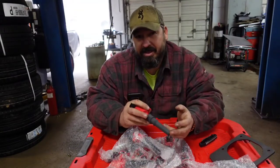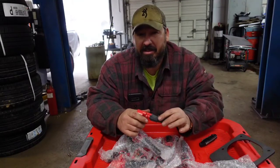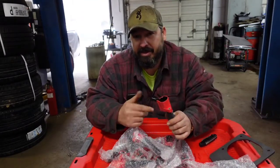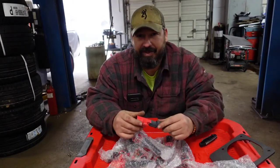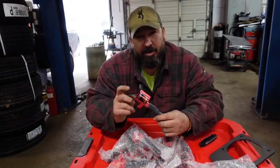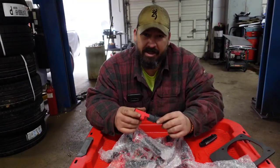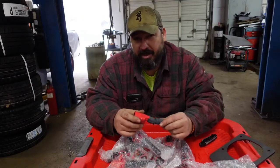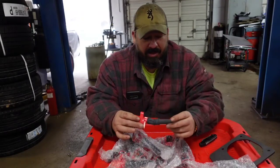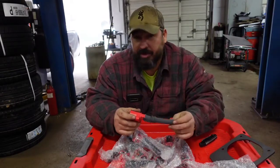Some V8s, V6s, and V10s have this issue - you may be fortunate never to have it. At a dealership it's about a hundred dollars just for a spark plug change because you have to heat them and use an impact to take them out quickly so you don't damage the threads. Back to the coil packs - changing them usually gets rid of the miss. It's probably two cylinders in bad shape: the oil in the second cylinder on the passenger side and the third or fourth on the driver's side from sitting.